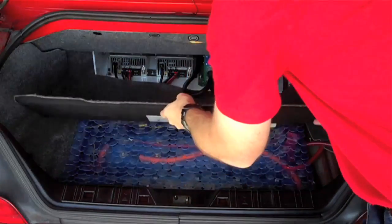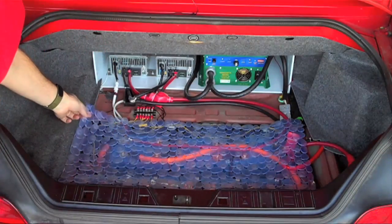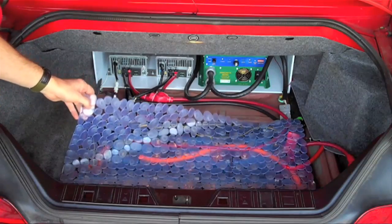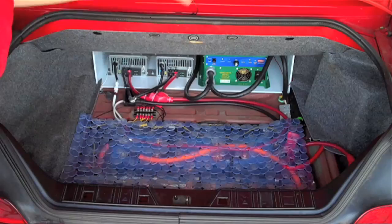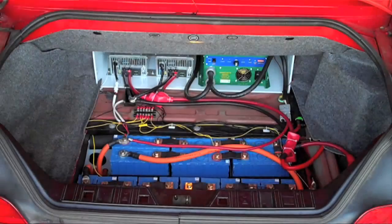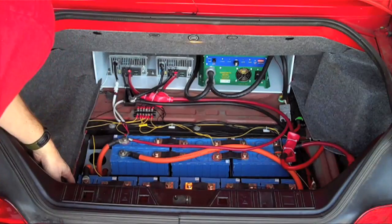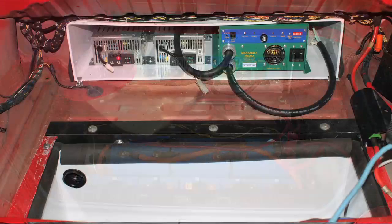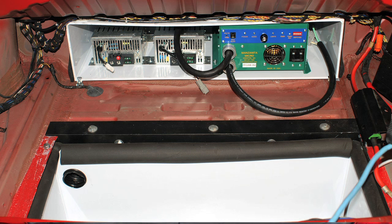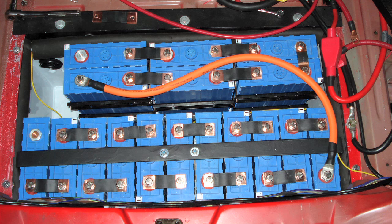Let's remove the floor of the trunk and I'll show you what's under here. This is actually just a plastic bath mat that I put over the batteries, mostly to protect them from stray tools that might drop on top of them, but it's ventilated so it works out quite well. I had to cut the floor of the trunk out in order to fit the batteries in here, and then I built a steel frame that is actually mounted to and bolted to the chassis itself, so it's very sturdy. I did have to give up the tool tray up here that held all the tools for the car, so I had to carry those elsewhere.